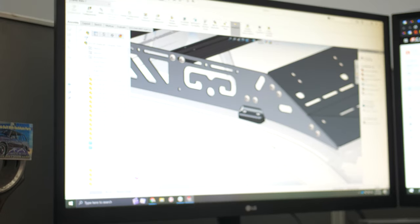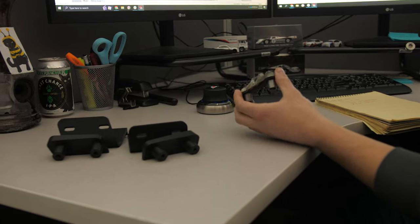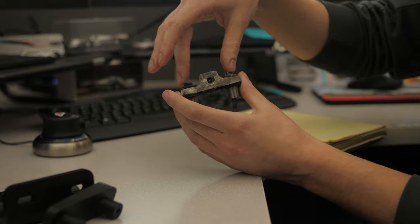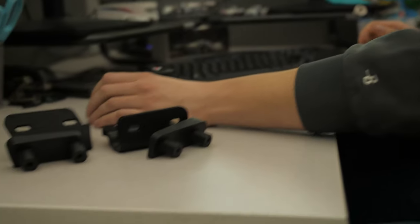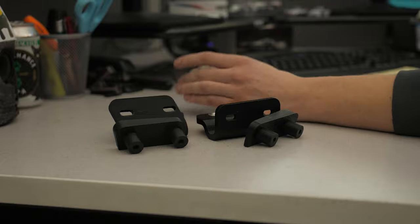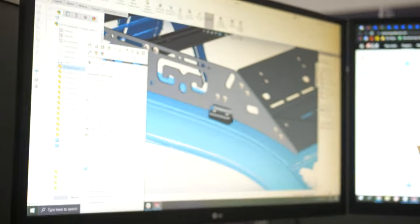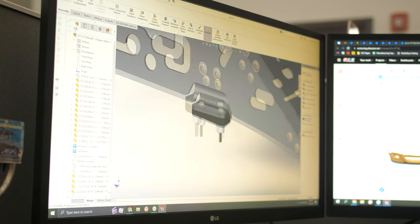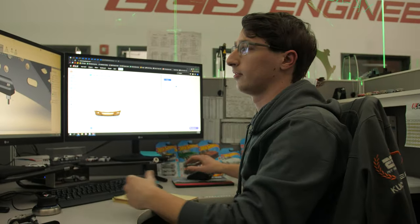And then in order to mount it to the roof, BMW does this weird cast component where the roof rail actually bolts through and then these bolts hold the stanchion down to the roof. So in order to make it a little bit more manufacturable and just make a more elegant piece than this, what we did was just a bent sheet metal bracket and then some cast poly pieces such that it seals against the roof and you don't have any water intrusion. And then some metal spacers so that you're not just squishing your poly out when you compress the bolts.